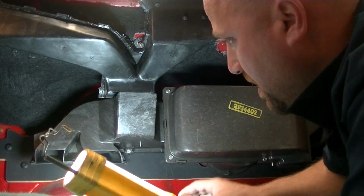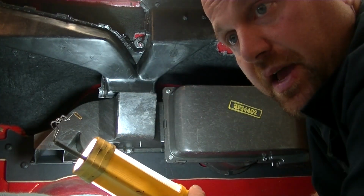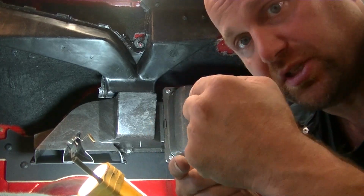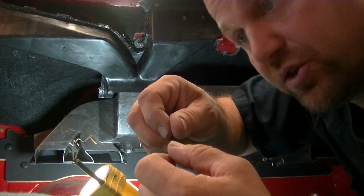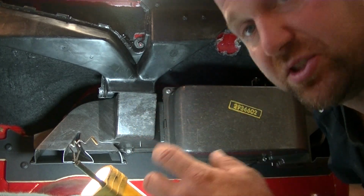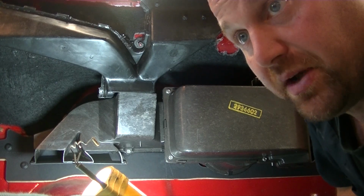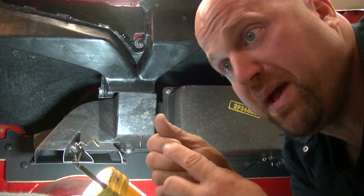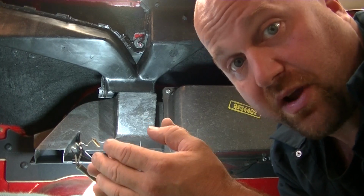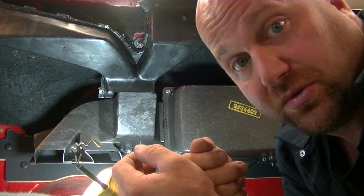So, the first step is put the firewall padding on, or firewall insulation on, push the clips through, and just make sure that when you're pushing them through, a little trick is to use a pair of pliers, go on the opposite side where you're pushing through, and pull that end of that tip through with a pair of pliers, and just wiggle it around a little bit. That'll actually pull it in, but just be careful you don't pull it too far, so it doesn't indent, as one of these did. But that actually helps better. If you push them, they'll bend, and you'll have a hard time. You'll know what I'm talking about if you've ever done one, or if you're doing one right now and you're stuck. Go on the opposite side, use a pair of pliers, and pull it right through, and you'll see that that will do the job.